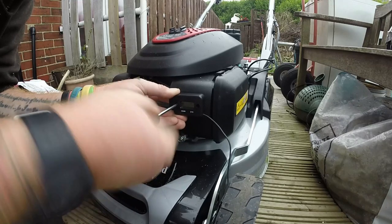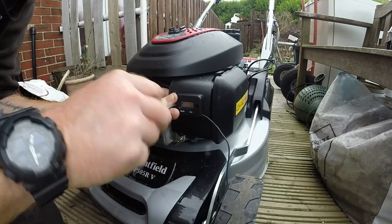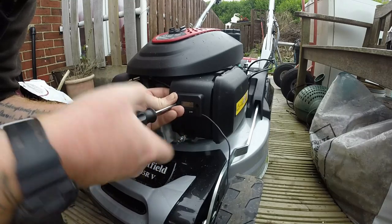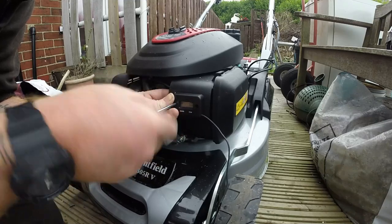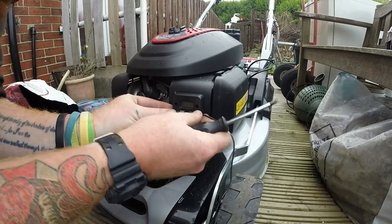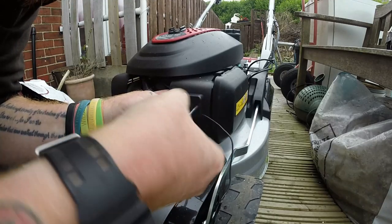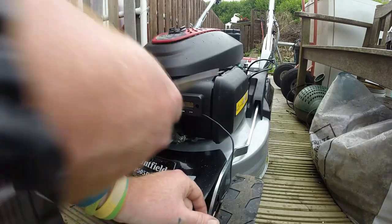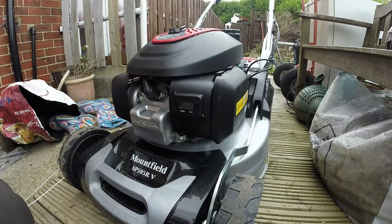With the filming it's taken me a little bit longer than normal, but it's literally less than a five minute job. Once you've got it tightened up, double check that your lead is right into the module — once it's in there it doesn't come out, but it's got to be in there tight or it won't detect. Any loose wire needs to be cut off, because if it comes in contact with any metal it will stop the unit from working.